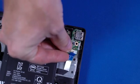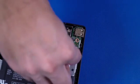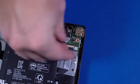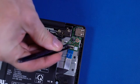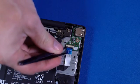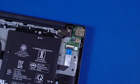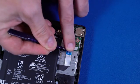Replacement. Slide the external connector into the cutout in the top cover and lower it onto the alignment pins. Replace the P1 Phillips-head screw that secures the USB board to the top cover. Insert the USB board ribbon cable into the ZIF connector and press the locking bar down to lock the cable into place. Replace the retention tape that covers the USB board ZIF connector.